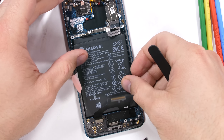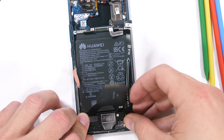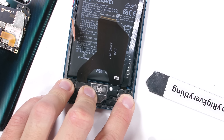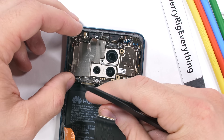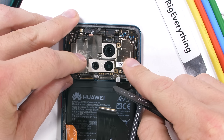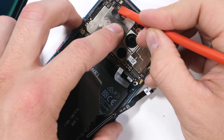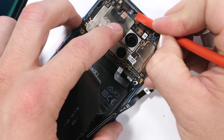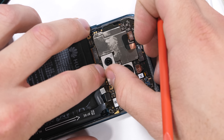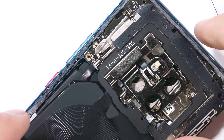I'll put the battery back in over the fingerprint scanner. Overall, it's not a bad phone to take apart — the back glass is tight, but once I'm inside, most everything in the phone like the battery, charging port, and speakers can be replaced with minimal effort. I'll make sure all the Lego-style ribbon cables up top are lifted up and out of the way before sliding the motherboard into place below them and clipping them all down. The bottom ribbon cable highway gets the same treatment, with the battery ribbon always getting plugged in last. The LED flash is plugged in, and the whole back panel and wireless charging pad can flop over on top of the motherboard and battery with its eight screws up top holding everything tight.